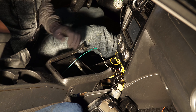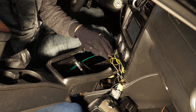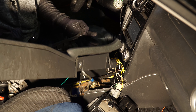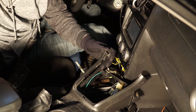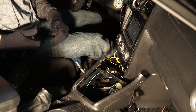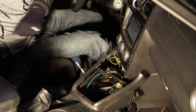Then all you have to do is slowly pull this section up and out. In my case, I had wired something inside the center a long time ago, so if you don't have any extra wiring you shouldn't have a problem. Now that's out, there are going to be some bolts down here that you need to remove in order to get to your e-brake linkage.